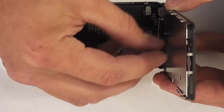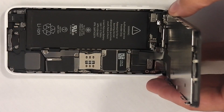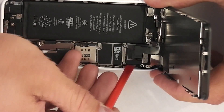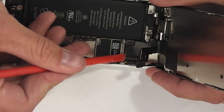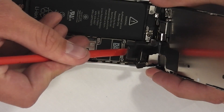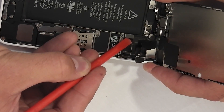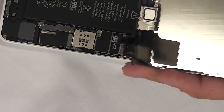Just take off the four screws that are holding this metal plate down, remove the metal plate, and then you can take your pry tool and just snap these little latches. These are exactly the same as the little battery connector that we just removed — really similar to Legos, so you can just pop them up and off. There are three latches that hold the screen on, and once you get those lifted up, the screen just comes away.